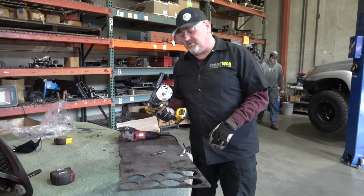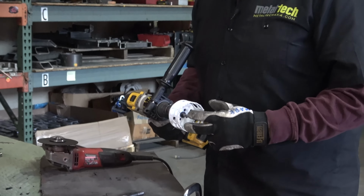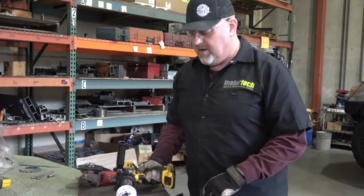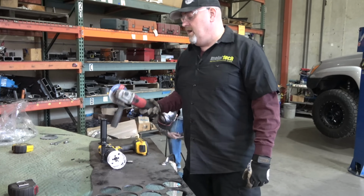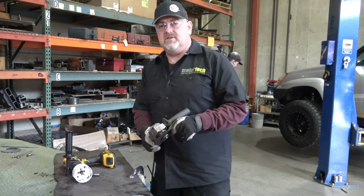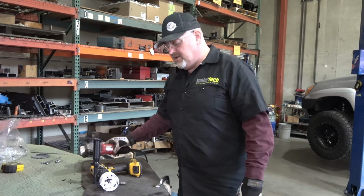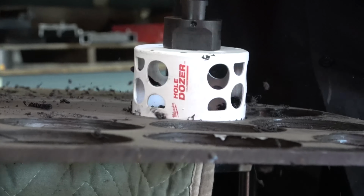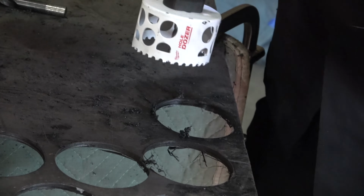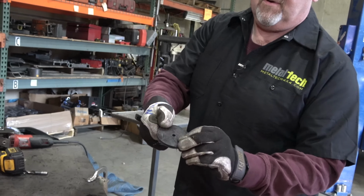We're going to take our 3-inch hole saw and knock a 3-inch hole in this chunk. What we're really after is the center part. The center part's going to be our actual spacer. So we're going to drill it first and remove the part. Then I'll switch over to a 1/2 inch drill and re-drill the hole so it's bigger. And then I'm going to use a cutoff disc to create a slot in it. You don't have to have a cutoff disc. You can cut it with a saw or whatever you've got. We just have plenty of these in the shop, so I can make the cut a lot quicker. So let's make the part. Fresh battery. Here we go. This is the part we're after right here. So knock the little burrs off, and we need to increase this hole size a 1/2 inch.